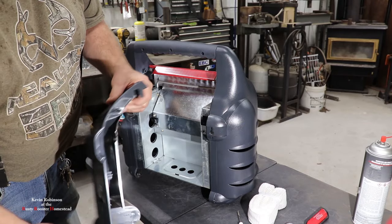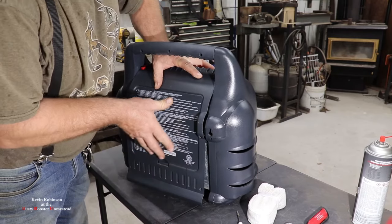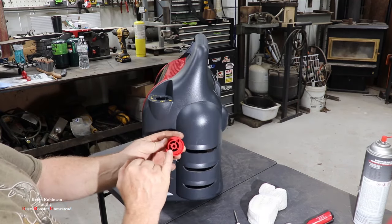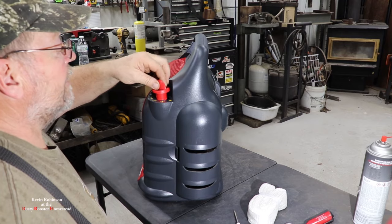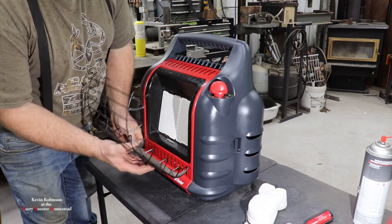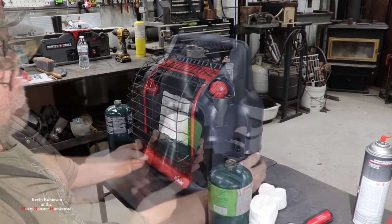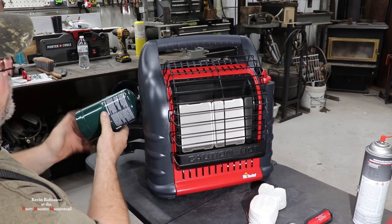Let's go ahead and put this thing back together. This piece here has two slots in it — you need to go up past those slots and then come down on it, and then it'll snap into place. Don't forget there's a little notch on our knob — make sure you line it up where it goes and slide it down on. We're going to put this front cover back on, pick up on it with your thumbs, and latch it into place. Now is when we can put our bottles back on — the one-pound tank. You never want to work on your machine with these bottles on; make sure they're taken out when you work on your machine.